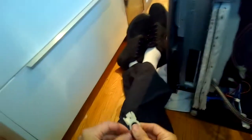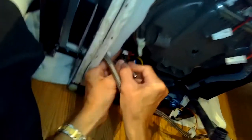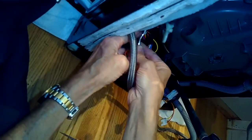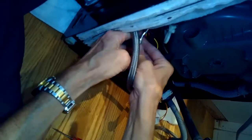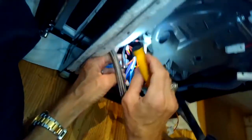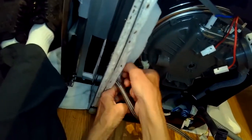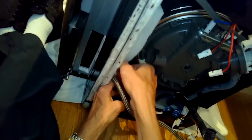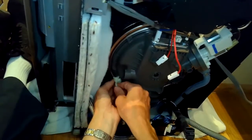There's another one down at the eight o'clock position. Just take a couple of spins and we can get this off and remove the sump from the dishwasher. We'll have to put the machine back on its feet to pull the sump out from inside the dishwasher — we can't get it out from the bottom. So we're just loosening it at the bottom first and we can push it up into the cavity, then get the machine on its feet and get the old sump out.